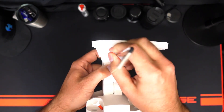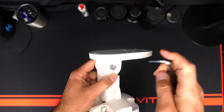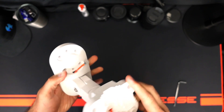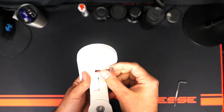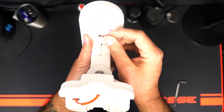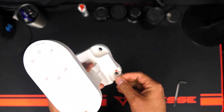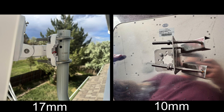Because this is a plastic bracket as opposed to the metal one on the original 4x4 MIMO, they've included a ground wire — you just put it on the closest bolt hole, run the bolt through it, and tighten it down. The hardware on the new antenna is also a lot beefier: the new one uses a 17mm nut on the U-bracket, whereas the original antenna uses a 10mm nut.